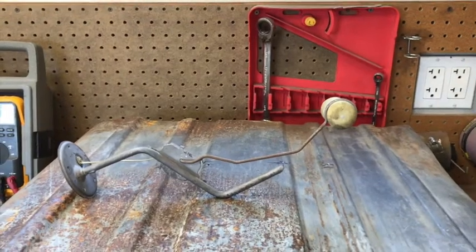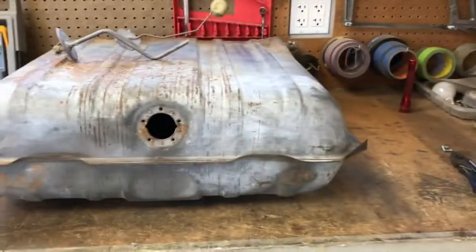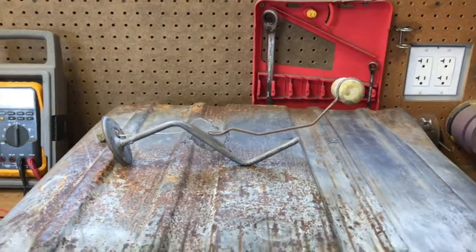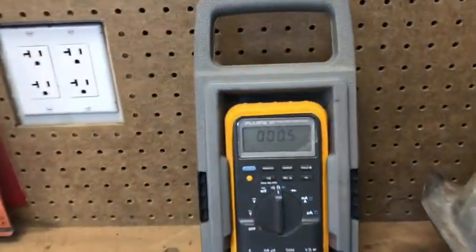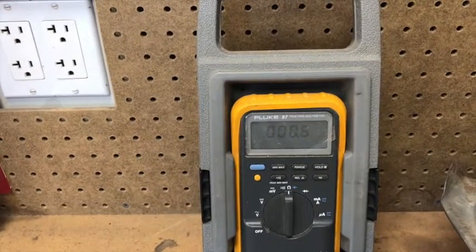So the float arm looks like this when you take it out of the box — just like that. See the bend on the bottom? This one was in this tank and it does not touch the bottom of the tank. The float does not touch the bottom of the tank. The rheostat works fairly well at the bottom — I think it's about 7 tenths of an ohm or whatever. This one here, as you can see on the ohmmeter right now, is hooked up. The one that I have adjusted — it's half an ohm. That's real close to zero.